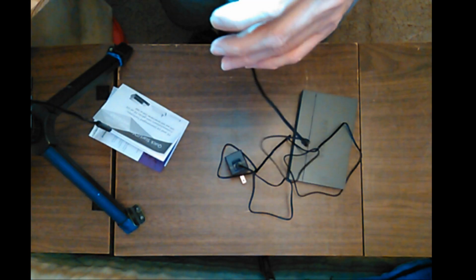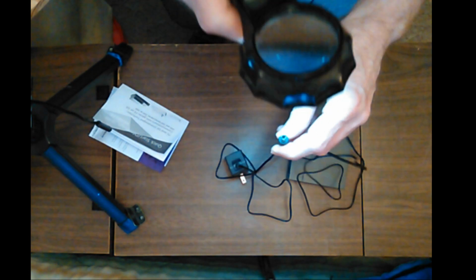That was what happened when the power supply went out on my switch, and I used other things over the years. I ended up just pulling a 5 volt lead out of a computer and doing it that way. Okay, so I used its cable. I cut the wire off, because I confirmed the power supply was completely dead, or wall wart, if you like to call them that, and I just ran it down to the computer inside of my server, because it was always on for a long time. Then it got to where it couldn't keep up, and I did check the amperage and all that before I did that too. But computer power supplies are very clean and regulated well, and probably way better than the one that went out.